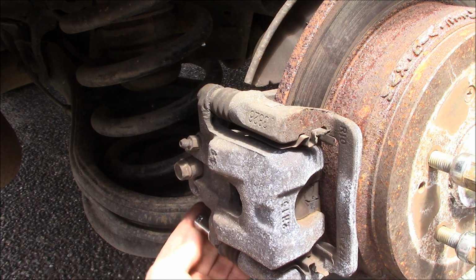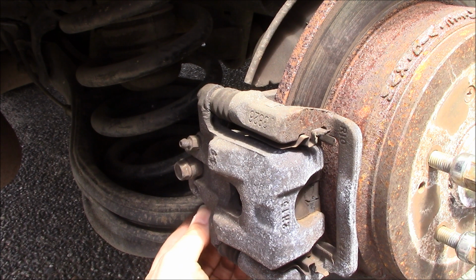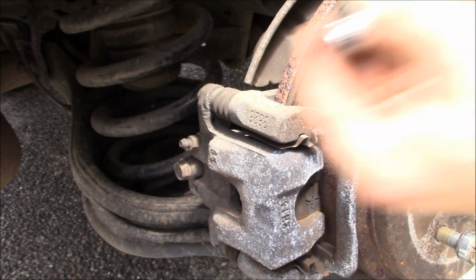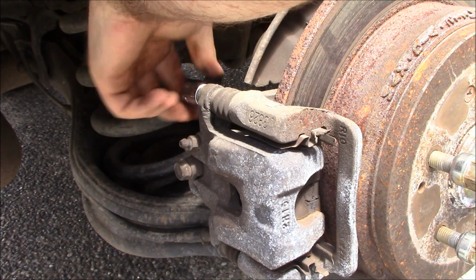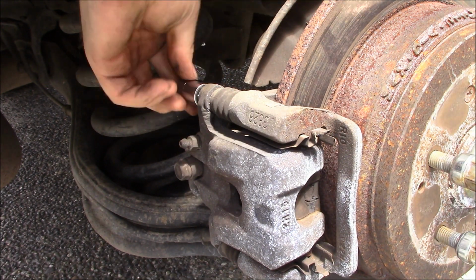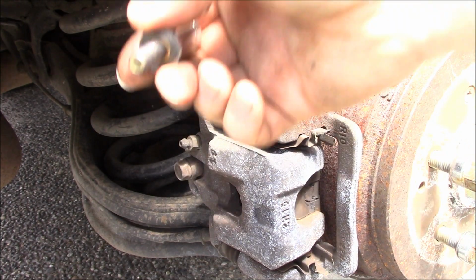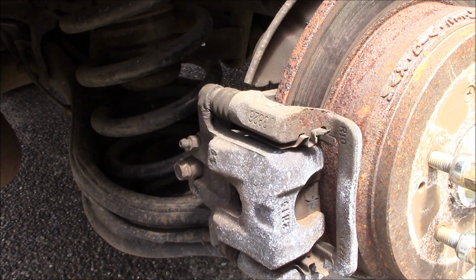What I'm going to do is wipe the old grease off of these slider bolts, and put new grease on them so they don't seize up. They're not that big, actually. So go ahead, put those where you won't lose them. Might as well put this rag to good use. Wipe my hands with it. Yeah, you literally get a free rag with your brake pads if you order through Bosch, apparently. Hey, that's cool.